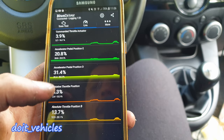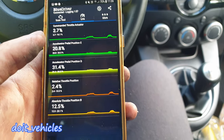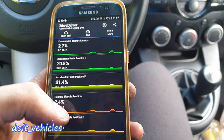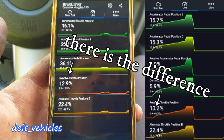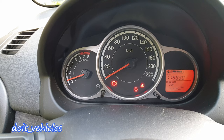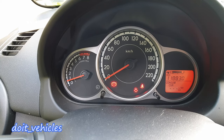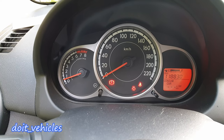What you want to see: take your engine-off values and compare them while the engine is on — that's how you know if there is any problem, if some of those variables interact with the signal. When you rev it up, you want to see how fast it will stabilize the idling — it has to be within a matter of seconds and should go back to normal. You can see there is a little bit of hesitation there. It's kind of insignificant, but over time it can progress and create more issues.